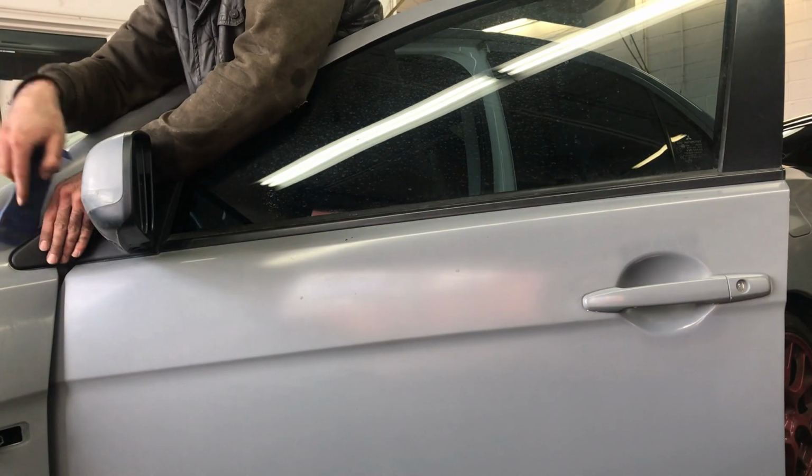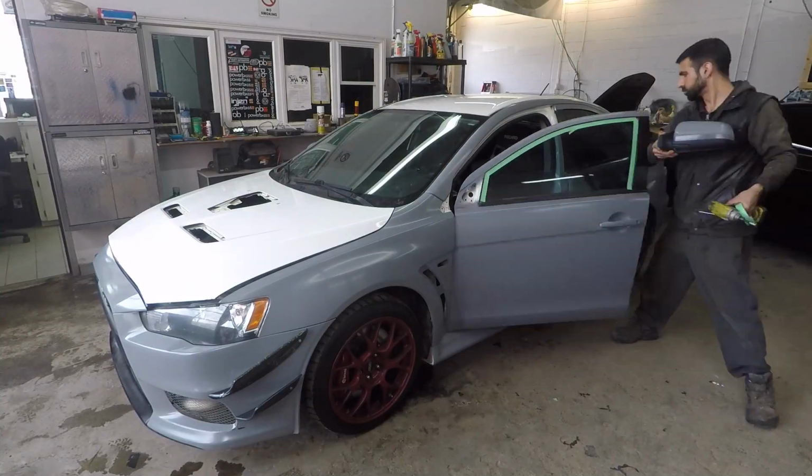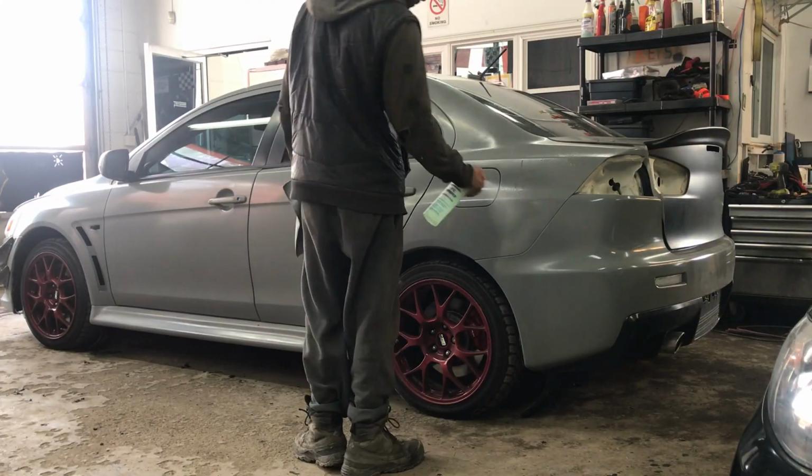Make sure for every vehicle you remove the rubber seals that are on top of the doors and that are held in by clips, which you can remove. This is important, or else you will get dips stuck on them and it could attach to the body of the car, which will cause it to peel when you open the doors.